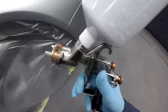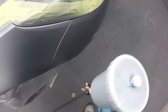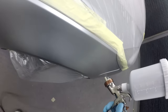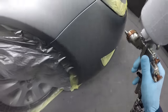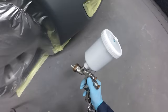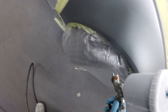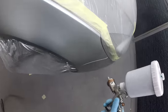Any of that overspray creates dust, and any of that dust is going to show up in your paintwork. I can't emphasise enough — if you're going for an absolutely killer clean paint job, you really do need to go OTT with your tack rag. Some people say I'm rather OCD about tack ragging, but there is no better tool while you're spraying, apart from your gun and yourself, than your tack rag. The more you tack rag and keep it clean during the paint job, the better the final result.